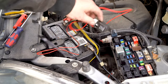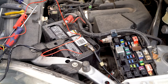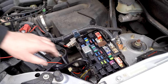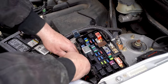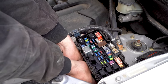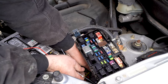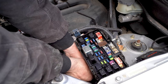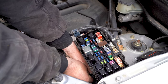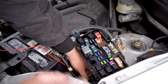We need to find a place to mount the relays. Most people just slop them in wherever, but notice the relays have nice mounting holes on top. We're going to mount them under the fuse box. Put them under there, figure out how much wiring to bundle up, add zip ties, and bundle it up nicely before mounting the relays under the box so nothing's hanging or dragging.